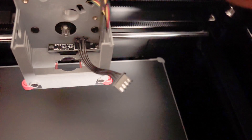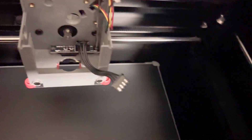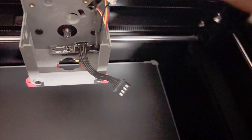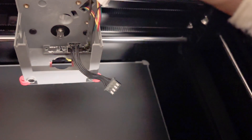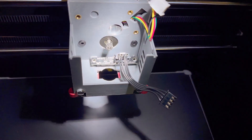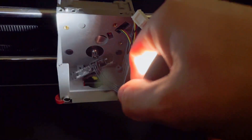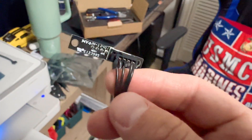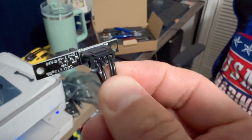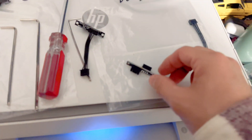I'm going to take out this last one — it's just two screws, that's all it is. It's pretty simple to get to, and you can see the interface board has already come loose. Just literally pull up on that and it should come right out. This is my first time doing this — boom, came right out. This is causing the extruder temperature error. Three out of the four wires on this connector somehow separated and I guess overheated it.